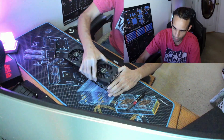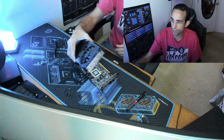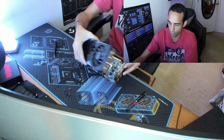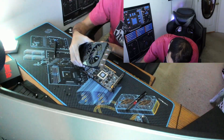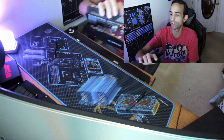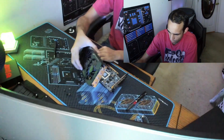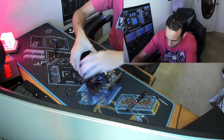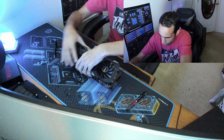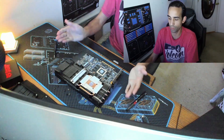This seems really fresh — nope, it's the old stock thermal paste. Now when you're pulling your heat sink off, there are obviously fan cables connected — probably a fan and an RGB strip. There's no RGB on this one, but there is an LED for the Gigabyte logo up here. The point is, be very careful while lifting up the GPU and try to disconnect any connections. In this case I don't really need to disconnect the LED — I can leave it just like this and work on it.